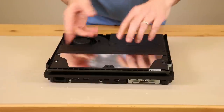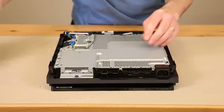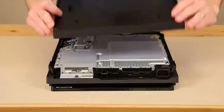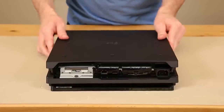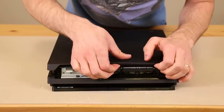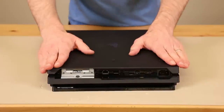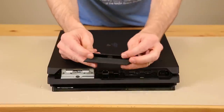After that's done, install all the screws back onto the power supply. After the screws are in the power supply, we need to flip it over and install those other two screws onto the other side of the PS4 Pro. Now that those screws are in, we can install the top cover and the bottom cover. Make sure the front is facing the front and that slides on like this first. Make sure it's all the way slid on, push down, and check that the tabs are lined up correctly as you push them down.